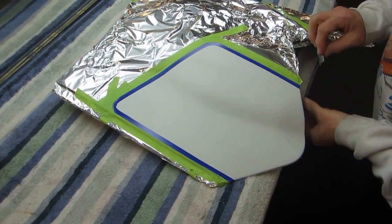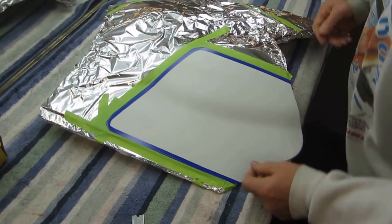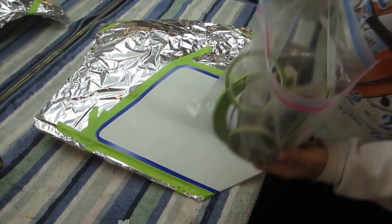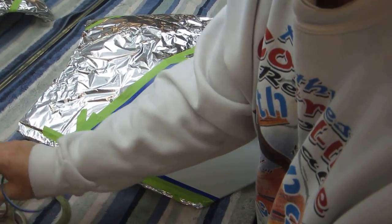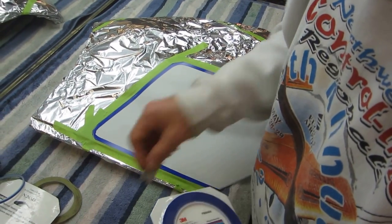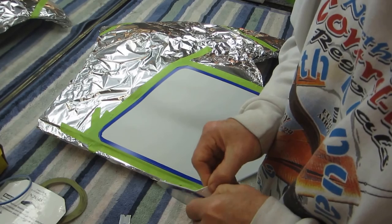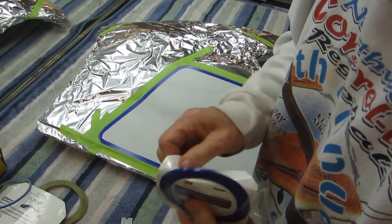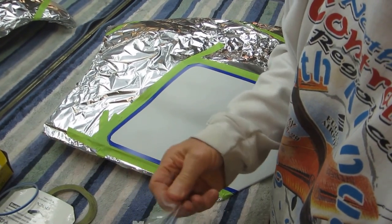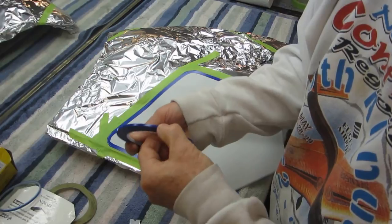If it's possible I'm going to try to get the black painted tonight, so the next time I get to work on this I'll be all set to go. You always need plenty of tape — tape, tape, and more tape. I'm going to take some of this; notice I'm using brand new tape, not old stuff. There's a simple reason: when tape gets old it gets less bendable, gets stickier, and becomes more of a problem. So if you really want to be like Chip Foose, you've got to throw some tape away at the end of the job.